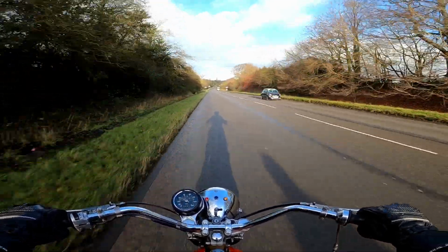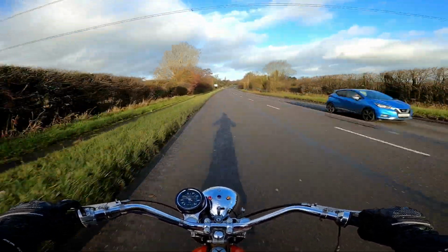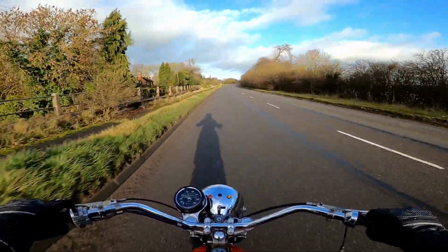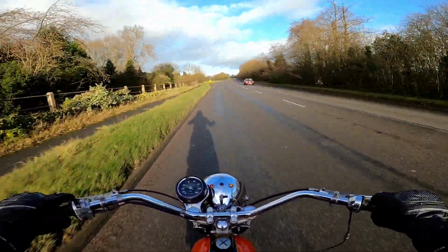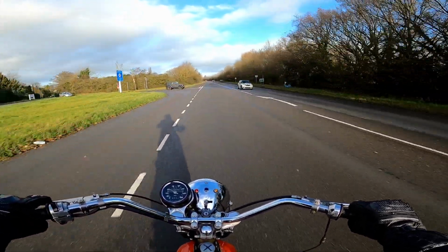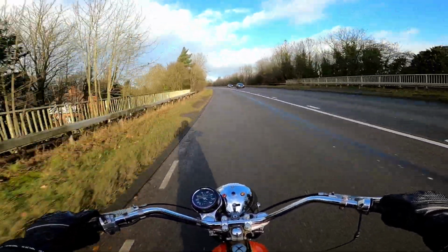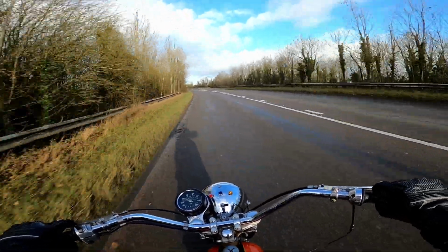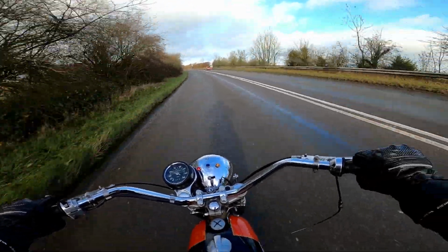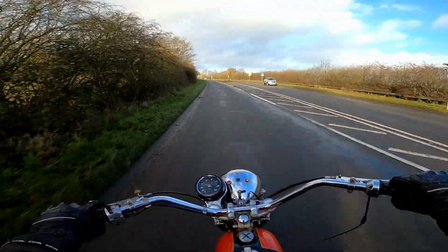He doesn't ride all that fast anymore. It's just something very, very light, very comfortable. It's monoshock, and it's jacked up a little bit now at the back in order to give some clearance for the oil tank that it needed under the back seat. He's got, I think it's off the Triumph Speed Triple, the rear shock, dialed right down, so it's particularly soft, got quite a bit of sag in it, so for long distance, with the way his back and his knees and whatever else, it's extremely comfortable. It's super light, so he can move it about.